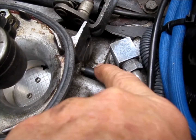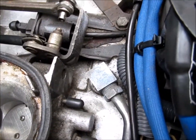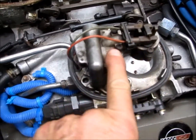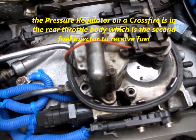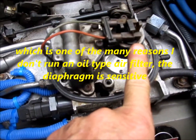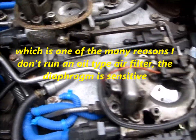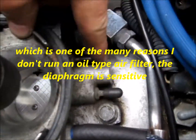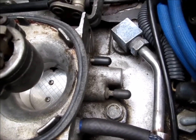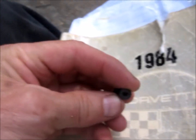When you take your breather assembly off you'll have to unplug the rear vacuum port for the thermac system, and that's going to have to be capped off. You'll need to buy a little rubber cap. Otherwise you won't get a good reading, mainly because the pressure regulator has a diaphragm in it that relies on fuel injector pressure and air cleaner pressure to operate properly.